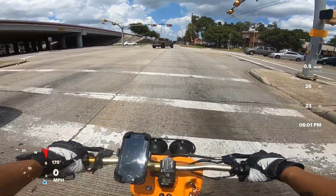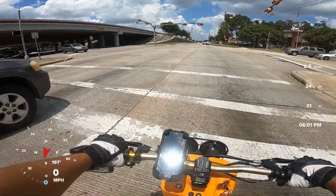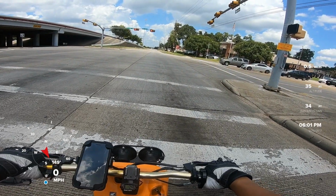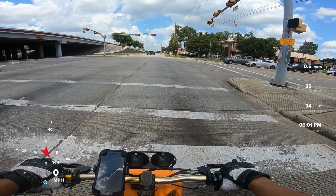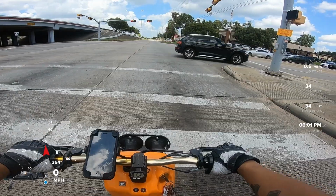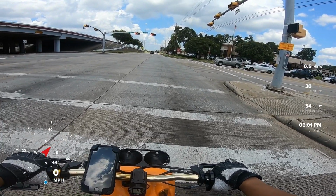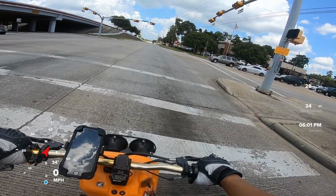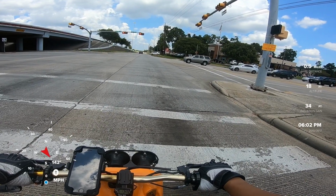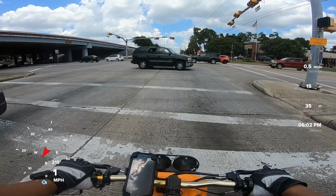Okay, oh, hey. So, changes on the bike since last time. I'm using 93 octane. Mostly 93 octane. There was still some gas in there from before, which was 87. And then I got the new exhaust, which has a very big header tube. I'm using 4.68 gram sliders. 4.68, Caesar? They make 4.68 gram sliders? No. I carefully measured 0.68 grams of aluminum foil and jammed it inside my slider, then reweighed them to match 4.68. Why 4.68, Caesar? Well, 4.5 was a little bit too light, so I went a little bit higher. But why 0.68? I don't know. That was the size of the first piece that I cut when I put it on, and I decided to just kind of keep it that way.